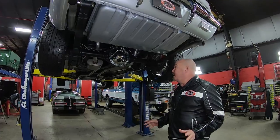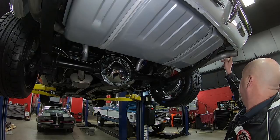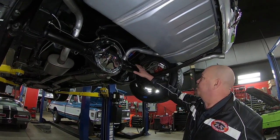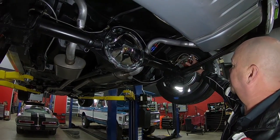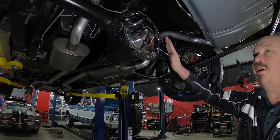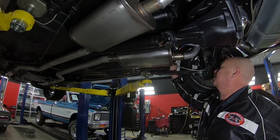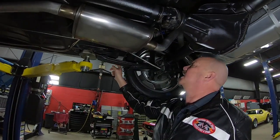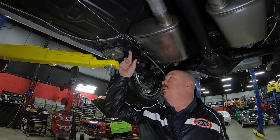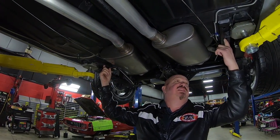We're underneath this Resto Mod Camaro now and it is pretty under here. You can see it's got a brand new tank, brand new exhaust, and the bottom side lips and back sides of the quarters are looking sweet. It's got new brake lines and a disc brake setup. Looks like the parking brake is hooked up. 12-bolt rear end with around a 3.55 gear and it is posi in this one. You can see all the pinch welds here look good. The back side of the rocker is nice and clean. Always look down in this area — it looks nice and clean. Always look at these holes right here in the frame — there are two pieces of metal welded there, and that's always a telltale sign.